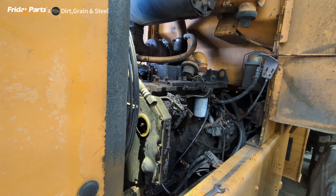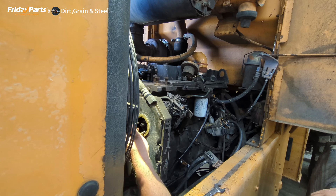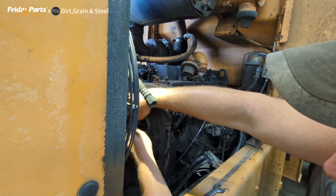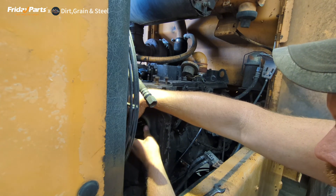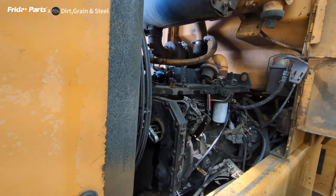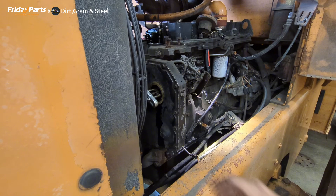I have a puller — I actually use this for the pulling truck, so when I adjust the timing on it I believe it will work on this one also. There's two threaded holes, but I don't know if this puller is going to work on this one. Nope, I'll have to go find a different puller — this is for a P7100 P-Pump, it's not the same. So I got that pump gear off. I just had to use a simple puller that I had, just tighten it up against the shaft and pull the gear right off. You've got to be careful when it pops, because if you've got your knuckles against this screen right here it keeps your hands out of the fan. When it pops it'll go real quick and you'll get your knuckles on that. So now that the gear is off, we can take the pump off and pull it out of the front cover.